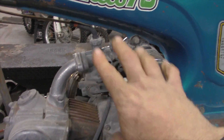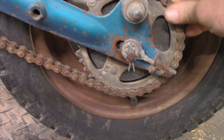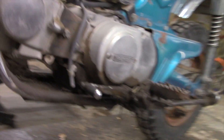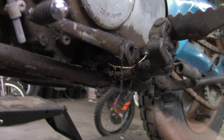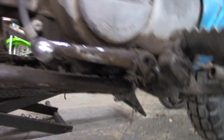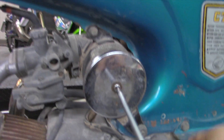We're obviously going to need a carburetor kit to rebuild that and make sure it's all good. Next we'll take the airbox cover off. The chain and sprocket actually look okay for now — we'll probably replace those but first we need to make sure it's going to run and start. There's a bit of an oil leak, looks like it's coming from the shift shaft seal because it's running down the shaft. The bike leans on that side, so we'll definitely get one of those.